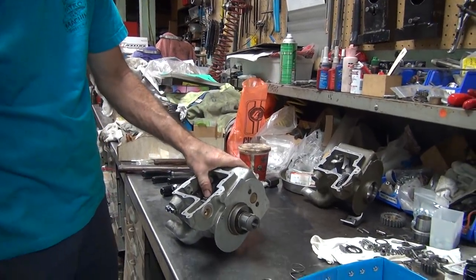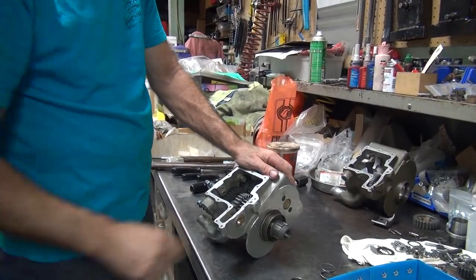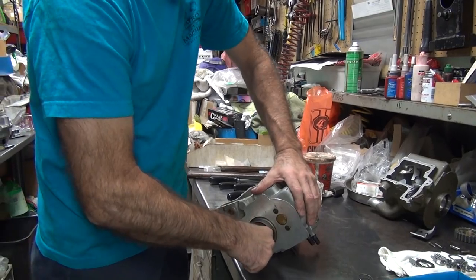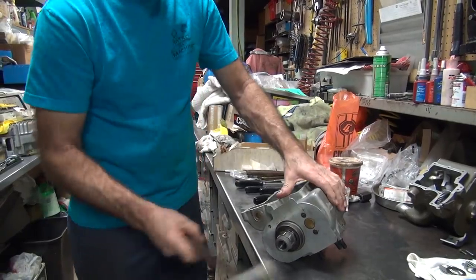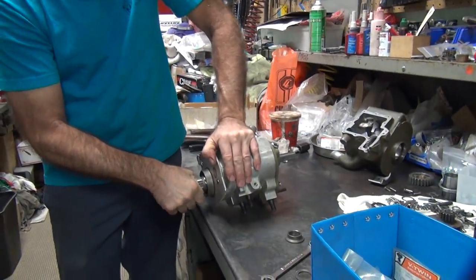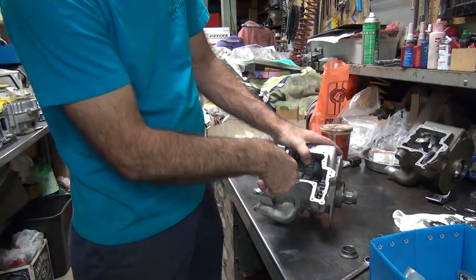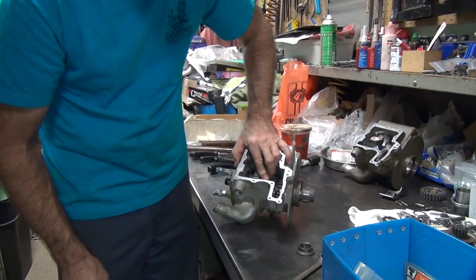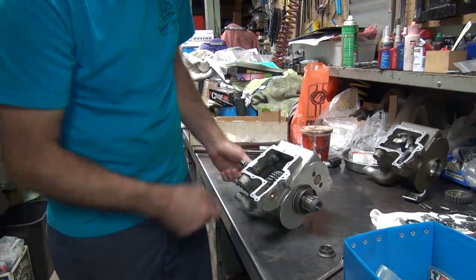Told you it's tight. Yeah, but where do you go looking? See how this one moves? How about putting the kick lever on there — see how this one's moving? So this one's not tight. See the end-play? Pretty close — that's not tight. So we know the end-play is fine. The problem is second gear's locked up. But see, there's second gear moving — look at that. So second gear's got clearance on it. So what the hell is tight? Is that stupid gear hitting again?